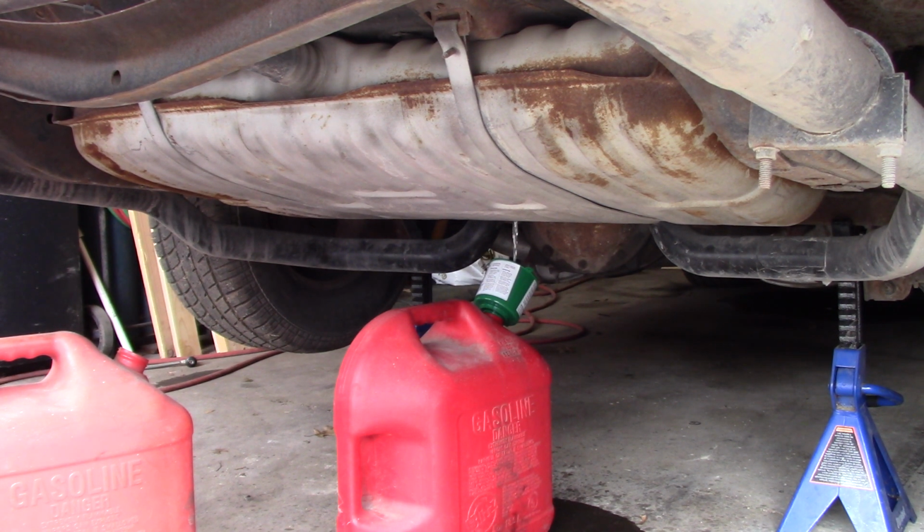But I did buy a fuel tank. I bought a new sender, and I bought new straps. And I think, if I remember, it was $240 for the whole thing. I had to order everything in different places, but I got them all on eBay, and it ended up being around $240 for everything. I didn't think that was too awful bad. I think that Mustang is going to be a lot easier to change the fuel tank on because the Fords actually bolt them in from the trunk. So you open the trunk, pull your spare, jack and everything out, and then the bolts are on top. You just unbolt it and pull the tank right out through the trunk.